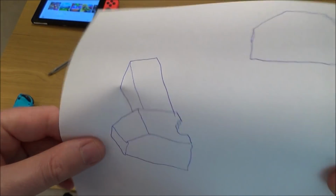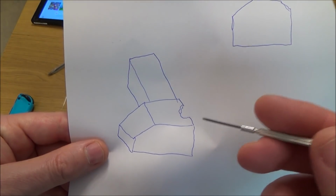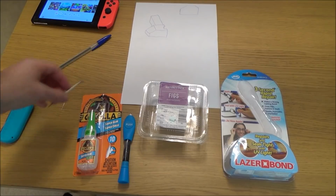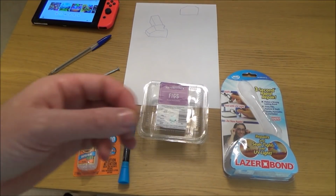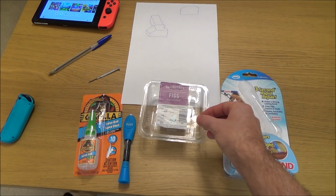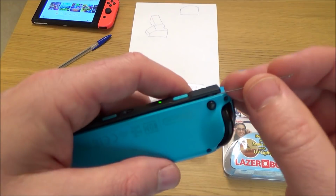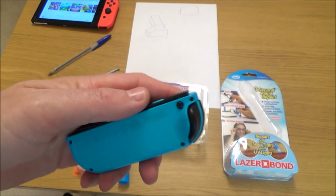So, well, I say it's my idea, it's not my idea. It was a comment on my previous video, and the guy said it's worked. So what I'm going to try and do is not take apart the actual Joy-Con, because I appreciate a lot of you out there don't want to take it apart. So I'm just going to be using some super glue, putting a dot of it onto the end of a needle. You're going to barely be able to see it, and I'm just going to tap it on the actual chip itself, and hopefully it will fill it up.